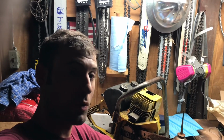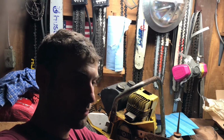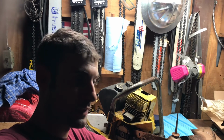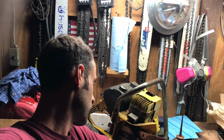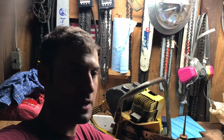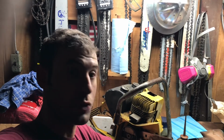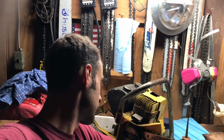But it's a strange carburetor. I've never pulled apart an SDC7. There's no fuel pump side to it. It's all gravity fed, and there's just a strainer in the fuel tank, and I cleaned that all out. And so put a new fuel line on it, and I reused the metering diaphragm. I kind of worked it a little bit, got some Vaseline on it, and then cleaned that off and put some 2-stroke mix on it. And so far it's working. I tuned it a little bit, and it seems to rev up really good. The choke is loose on it, so I don't really know what to do about that yet either.